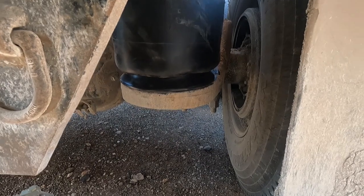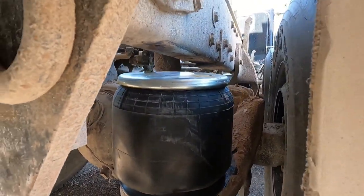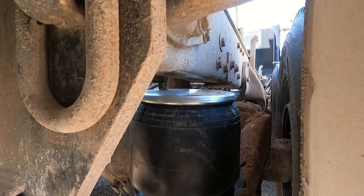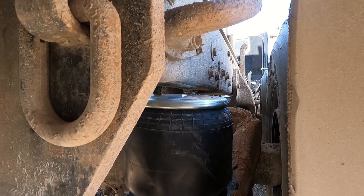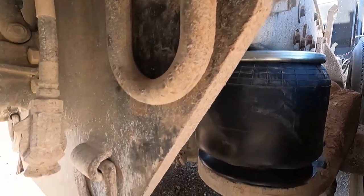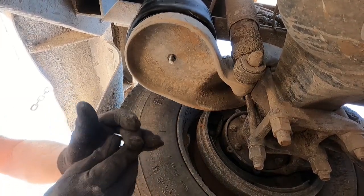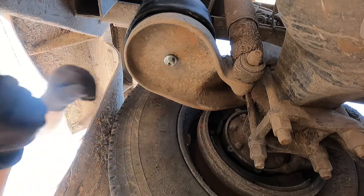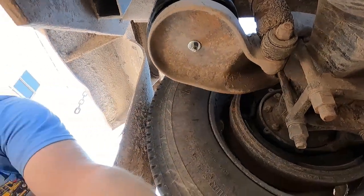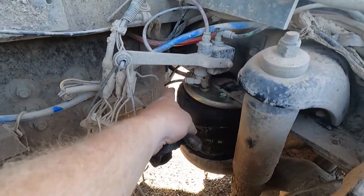So I'm gonna let this jack down until that's almost on there. And this jack's probably gonna try to shoot out. Maybe, we'll see. So I don't have to fight trying to pick up on it. And now I can start the top bolts real easy and secure the bottom air lines and I'm done. Get the squirt bottle out, see how bad they're leaking. Well, it looks like I bent that T a little too much. Take it apart. I got one in the truck.